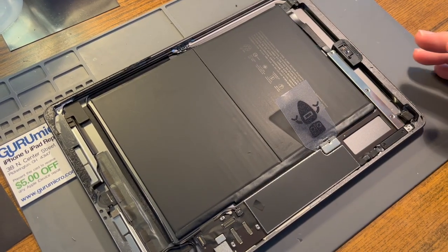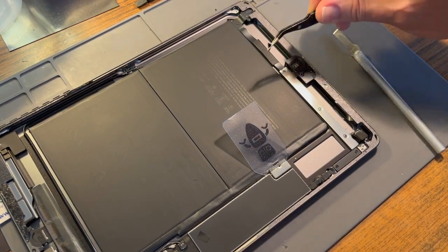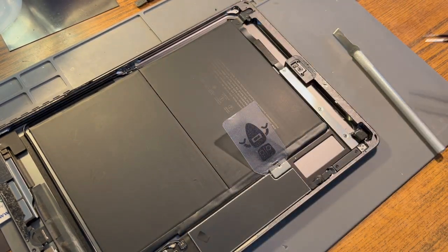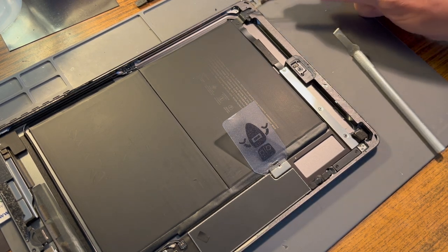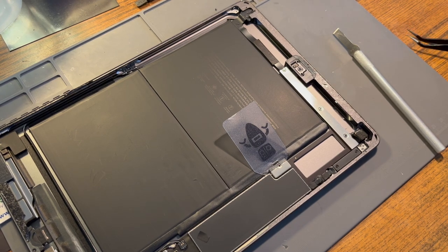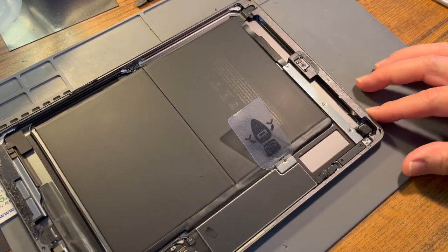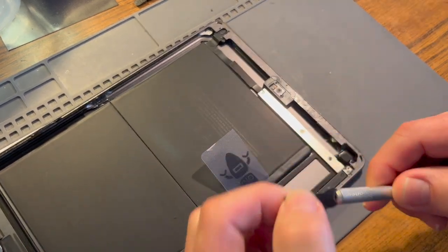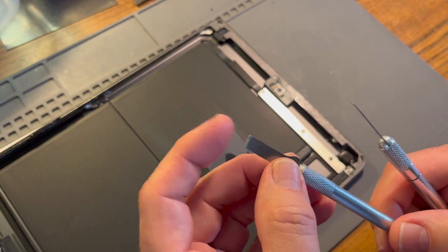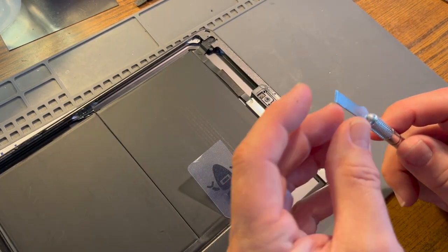I'm going to show you real quick — little fragments of glass are sometimes floating around inside the housing. It's always a good idea to check that out. I'm going to hit this with compressed air before I put everything back together, because if you have a little glass fragment floating in here, it can actually work its way around and get stuck between the LCD and glass over time. You don't want a little piece of glass floating around underneath the glass and on top of the LCD. When I'm doing this adhesive scraping, I like to use the exacto blade that is razor sharp — and this tool to me is ideal for this. You go around applying quite a bit of force — it's actually flexing the blade — just scraping it off.